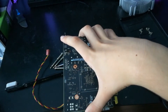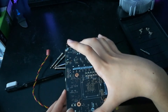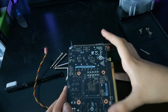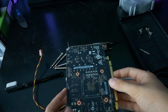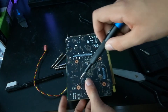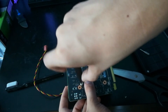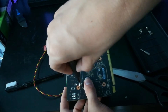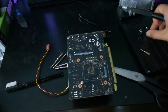After securing the fan, apply thermal paste and flip over the cooler. Then lay the card on top. If you have an asymmetrical heat sink, make sure it's oriented correctly — on mine, the mounting points are not centered and one side bulges out. That side that bulges out goes toward the front of the card, away from the PCIe connector, otherwise it'll block the connector and you'll have to take it all apart again.